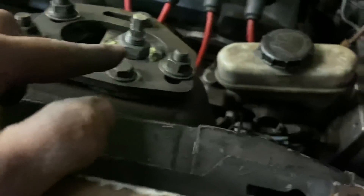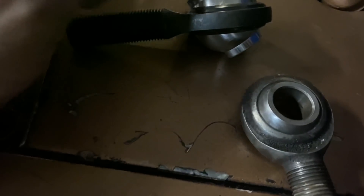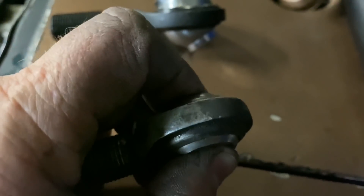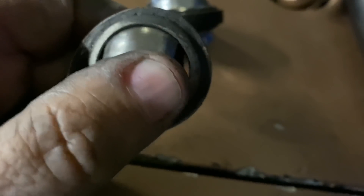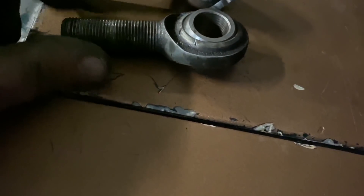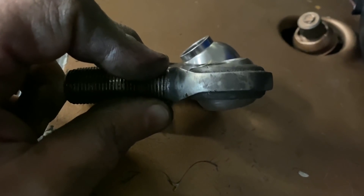Okay guys, look at the difference in this. When I did the video with the high travel extenders for the front end, one of the things I needed was a high travel misalignment — that's what this is. It's five-eighths, five-eighths reverse thread, same as the old one, but look at the difference. The old rod end is definitely loose and moving, though it's not all the movement I was feeling — the rag joint down there is bad too. The new one's ball is just thicker and bigger, and the angle it can go before it bottoms out is tremendous.